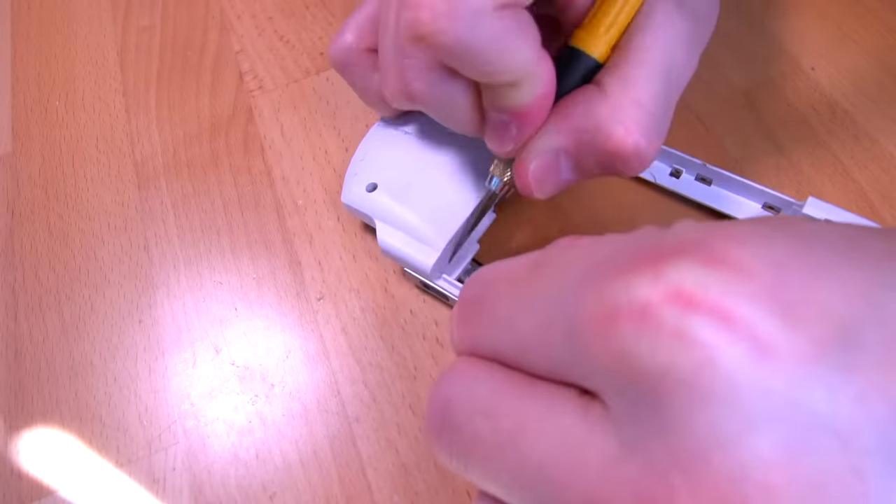Starting with the pros: the IPS screen looks fantastic, and it's as close to a drop-in kit as we've seen, primarily because it no longer requires an adapter ribbon cable. The image quality and improved ghosting are welcome enhancements over the original screen. Now for the HDMI kit — in the grand scheme of things it isn't too difficult to install, as far as HDMI kits are concerned. For example, a lot of home console HDMI kits require extensive soldering, while this one primarily utilizes the LCD connector with just a few wires to solder for audio. The biggest pro is that we can now play PSP titles on the big screen — the PSP is well suited as a home console, as many of its titles have a caliber similar to that of its bigger brother of the time, the PlayStation 2.